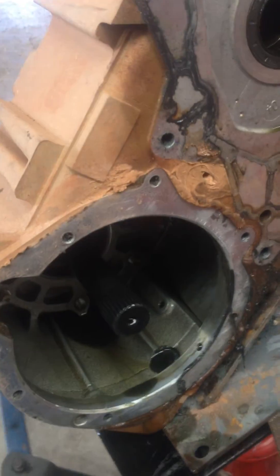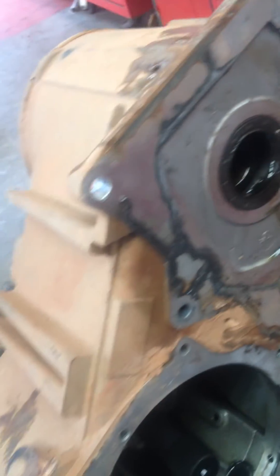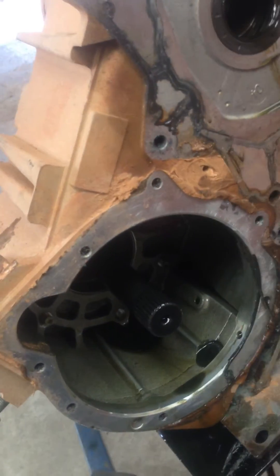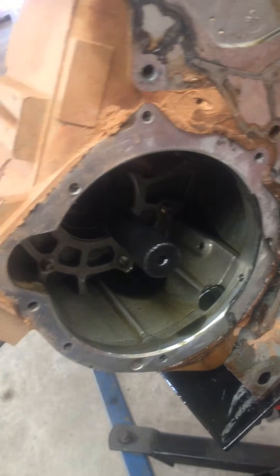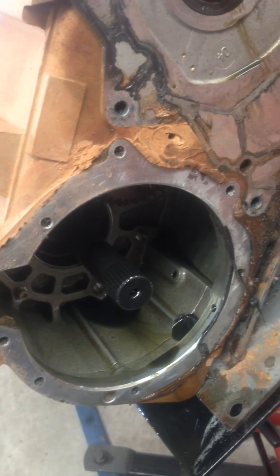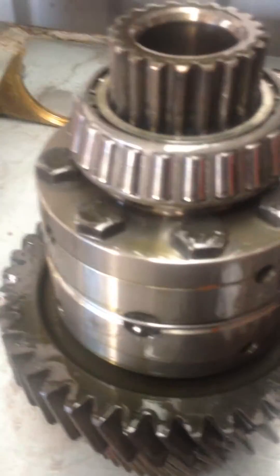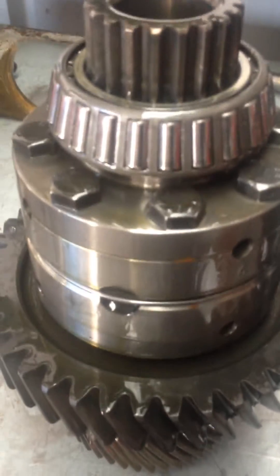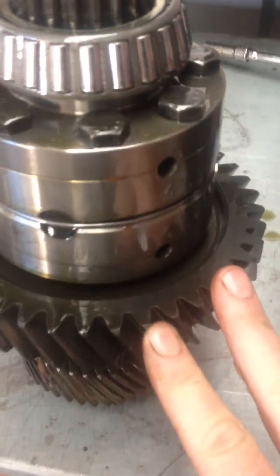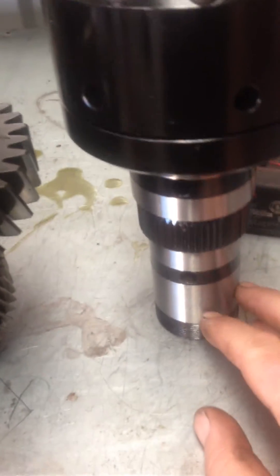Over at the transfer case — it's fairly low mileage and the customer really doesn't want the added expense of rebuilding the transfer case, so we're just doing the center diff. I'm of two minds — I've already got the transfer case out, so let's strip it down and rebuild it anyway. All I'll do here is strip the top and bottom bearing off, throw them away, strip all these gear sets off, and fit them to the Ashcroft one.